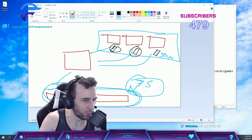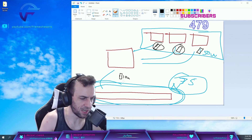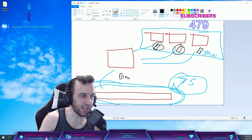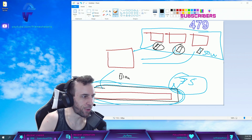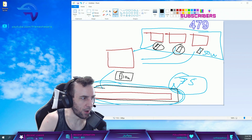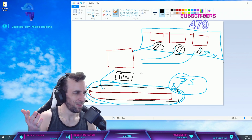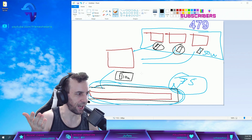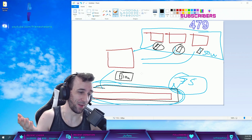This one is a 10 amp fuse on the PCIe slot. So the EVGA engineers made this slot pull an extra third of power more than it's supposed to, and then put a smaller fuse on that power rail. You can see where the problem is — you can see where I'm going with why New World was bricking EVGA 3090s specifically.